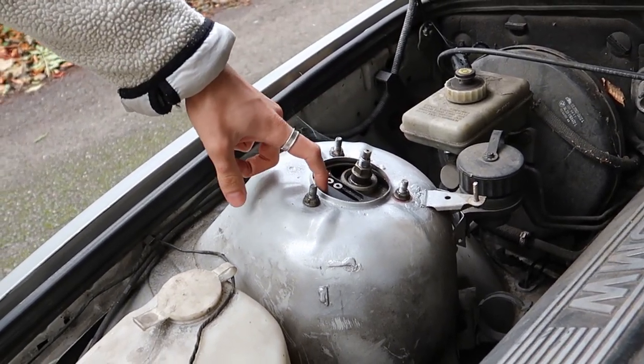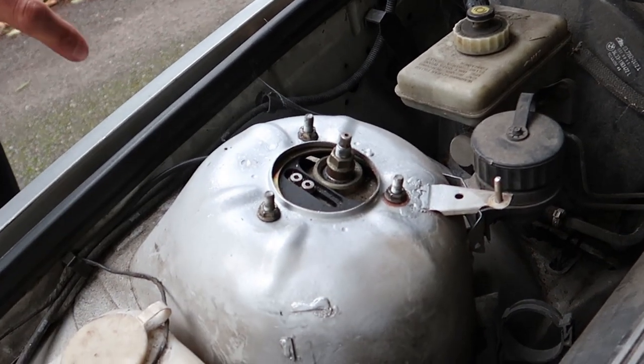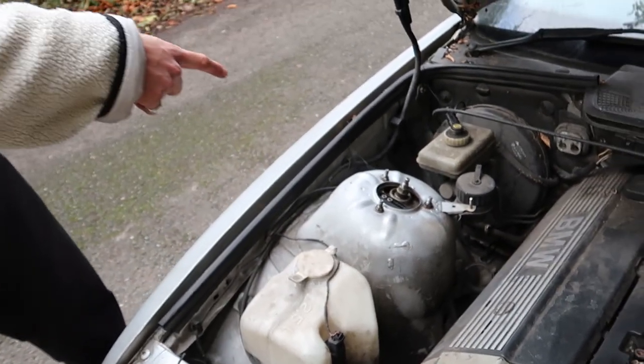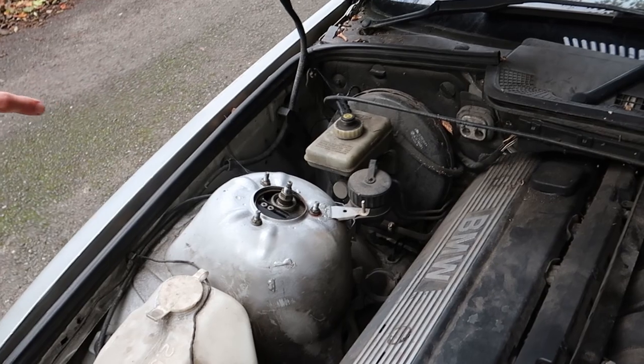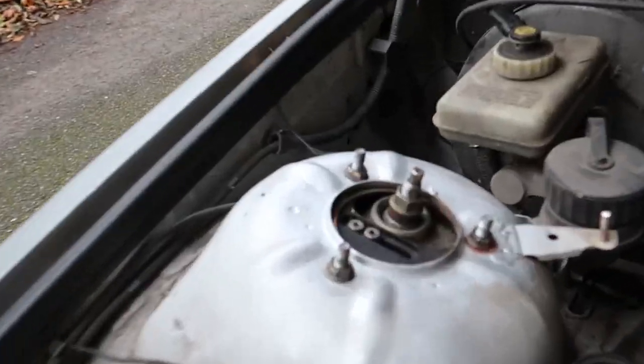So here we've got these strut towers reinforced with E46 strut tower reinforcement plates underneath, and I'm running the HSD DualTech standard spring rate setup. It's got the caster offset on the top hat, and it's got the camber adjustment. I think my camber at the moment is maximum positive, just to make it fit nice. Just good fitment and, I don't know, better steering.